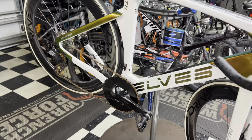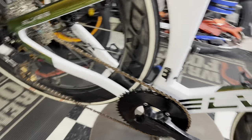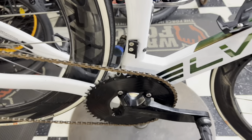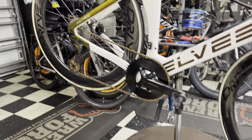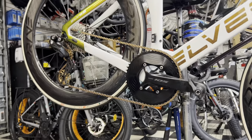You can figure out that configuration because you get a better chain line, you get better shifts, and you also get less friction and less resistance. We have less to worry about with chain drops and less maintenance in terms of a front derailleur with chain rub. It just all in all looks way sexier, functions much easier, and there's less to go wrong on your bike.